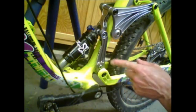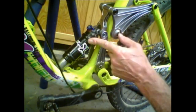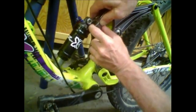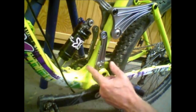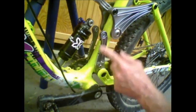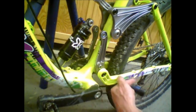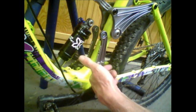So how does it work? To give a clear picture of what's happening, I remove the upper bolt holding the missing link under the upper shock and the driven link from the rocker. This will let us separate the links and show what's happening. So the missing link we see is pivoting on the frame with the chainstay pivoting on the missing link. This allows the link to respond to the horizontal forces forward for pedaling, rearward for bump, and allows the missing link to rotate in a direction to assist compression or resist compression.